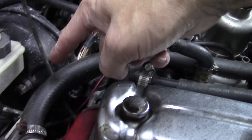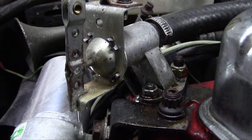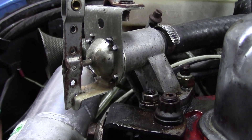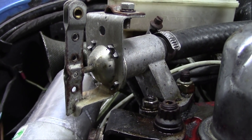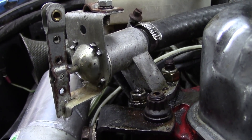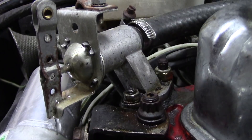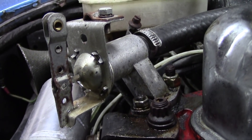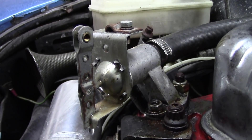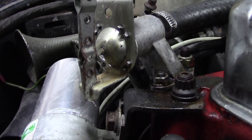It's coming around here to this bad boy right here, and you can see the water leaking right there. What I also failed to mention in my previous video was that I lost my indicators — my blinkers. I'm wondering now if this water dripping on wiring somewhere may have affected that, because all the while, while this happened, we did get an electrical smell that smelled hot.